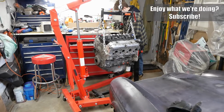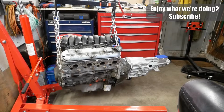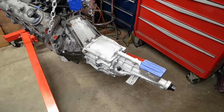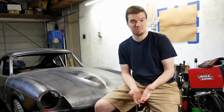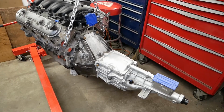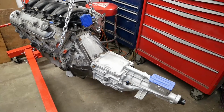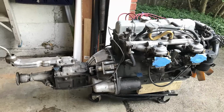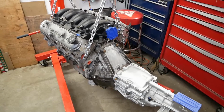We're mating the LS4 to a Tremec T5 out of an 04 Mustang V6, using a bell housing from an 85 Jeep CJ. Obviously. For more info on that, check out the last episode. With it all bolted together, we've got a pretty darn tight package that is about the same size and shape as what it's replacing, yet it weighs less, lowers the center of gravity, and makes 3 times the power. This is a really good start, as it takes care of the first 2 large components of the puzzle.